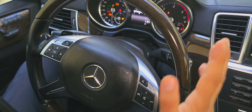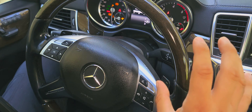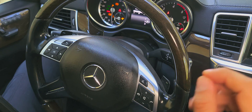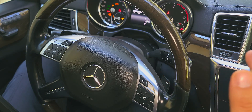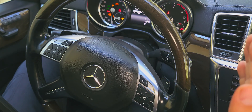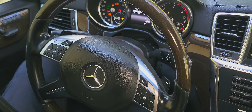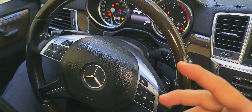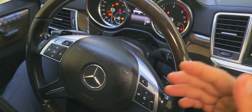On this Mercedes — this is a 2015 GL350 diesel — on the diesel ones, you've had to do injector coding for quite some time now. On Mercedes, especially direct injector engines like the 3.0 twin turbo engine for example, you have to do fuel injector coding on those as well. This has the 3.0 liter, the OM642, which is the engine code, found on Sprinters, ML320s and ML350s diesel, and so many other Mercedes models like the S350 Bluetec and so on.